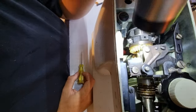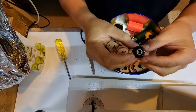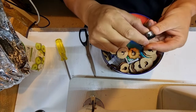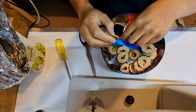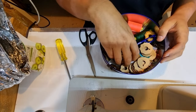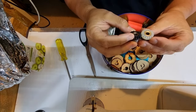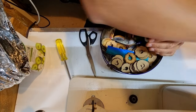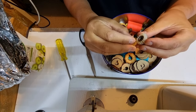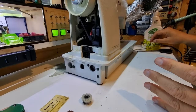This is my collection of spare bits, and I have a 3D printed bevel gear that might suffice — I heat-set that onto the original gear. This was out of my own machine; the bobbin drive gear fell apart in that one. This might actually fit. Let's see if the tooth profile is the same as the broken bit. It's even got a timing mark on it — I might actually have a gear that fits.